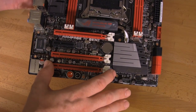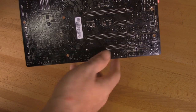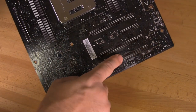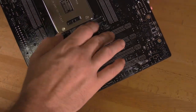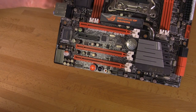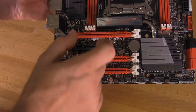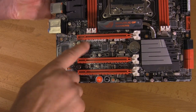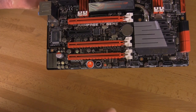You have your PCIe X16 slots — the top one is going to be PCIe Generation 3. Flipping it over to the back, you do have two full X16 slots as far as their electrical connections and one X8. These two X16s should operate in X16 mode, although you're only going to get one slot that operates in Generation 3 from our understanding — we'll follow up with more information on that once we get into the performance testing. You also have an X4 slot with an open-ended back so you could put a longer card in there as long as it's capable of running at X4 only.